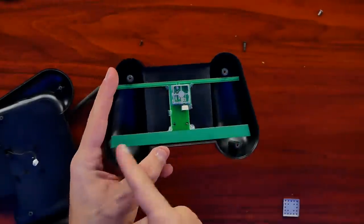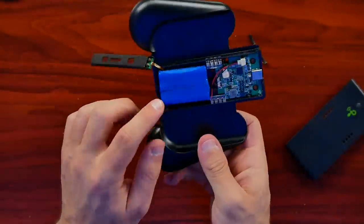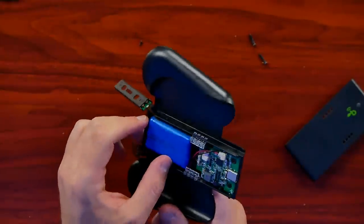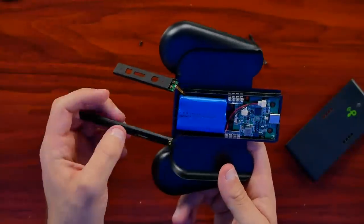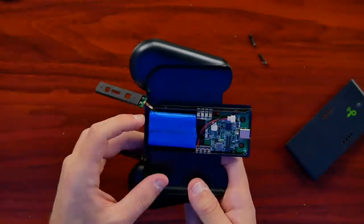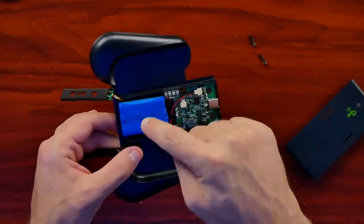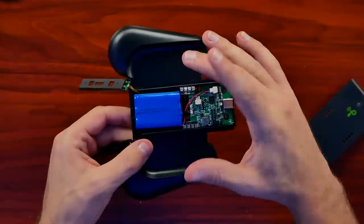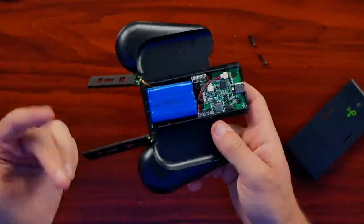The antenna goes from end to end and also down here. With those screws off, the front plate pops out and we can see our larger batteries. Picture if you took a couple of AAA batteries, almost wrapped them up, and dropped them here — that's kind of what they did. It's 960 milliamp hours at 3.7 volts. This will recharge the Joy-Con controllers — each one should get a full charge off of this, which is kind of the idea for these grips: to give each Joy-Con controller basically another charge.